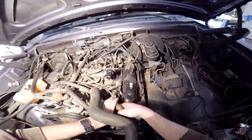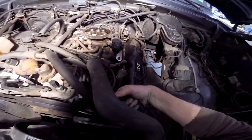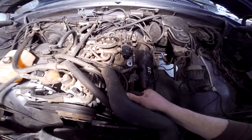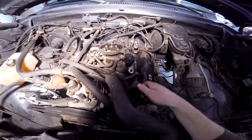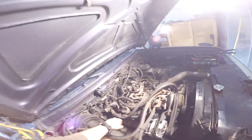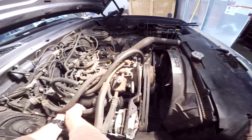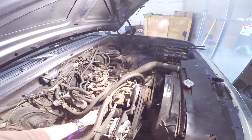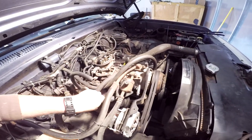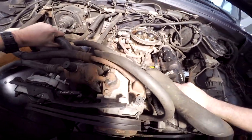With that being said, I do make a note in that video that having this pump here, I'm going to leave it because the belt's squealing, because I think it was pulley alignment. Well, the forums were talking about how it's probably not a pulley alignment, it's something else. It shouldn't be squeaking, but I'm going to leave it there until I find out what's causing the squeak. One recommendation was probably just being a POS belt, but I'm not sure yet. So until I try that out, I'm gonna leave it on there, because I'd much rather not have it squealing and worry about a belt blowing. So, just a heads up, guys.